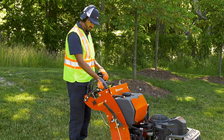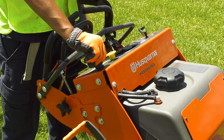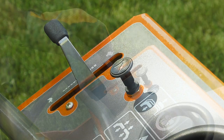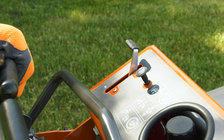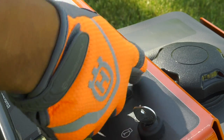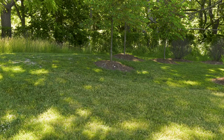If the engine doesn't start, wait approximately 10 seconds and try again. When the engine starts, the operator releases the ignition key back to the run position. If the choke was open for a cold start, push the choke control knob back in at this point. Finally, the operator sets the engine speed with the throttle, letting the engine run at about mid-throttle for a few seconds before moving to full throttle for mowing. With the engine started, the operator will release the parking brake, pull the blade switch up to engage the mower deck, and grasp the safety bar and steering controls to begin moving.